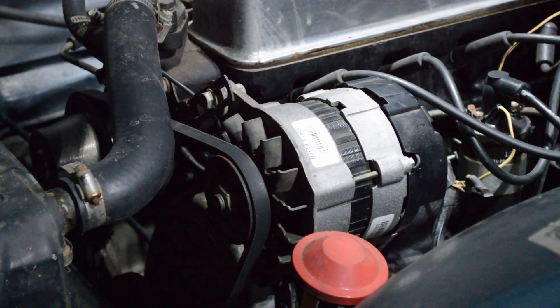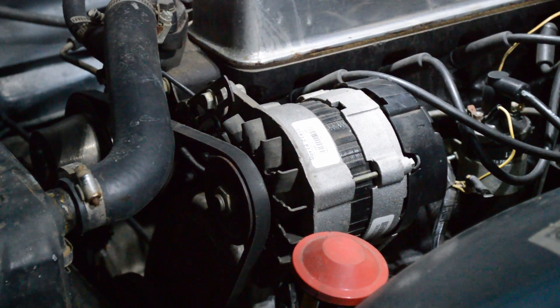At this point you're going to have some options. We know the alternator isn't performing as it's supposed to because the voltage coming out of it is too high, so there's a bad regulator — that's the most likely cause. We could either fix the unit that's in there or replace it. Replacing it with another Lucas alternator is going to be a lot more expensive: a regulator is usually around $20–30, while a remanufactured alternator could be $100–200.